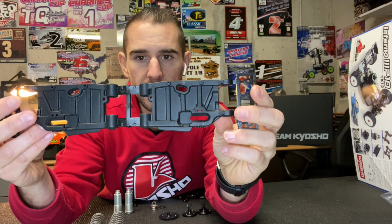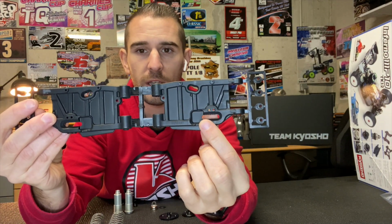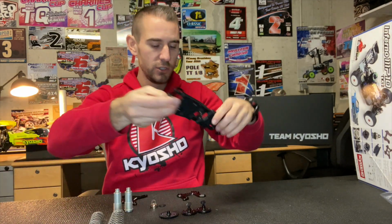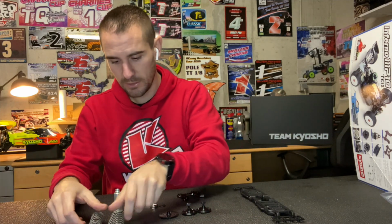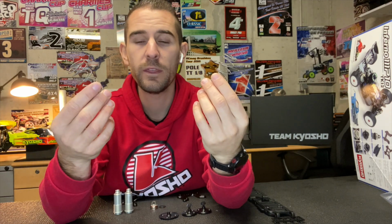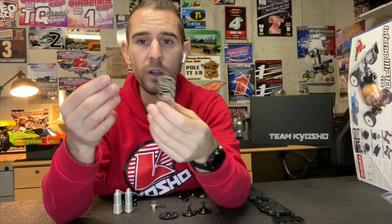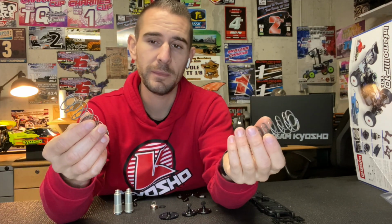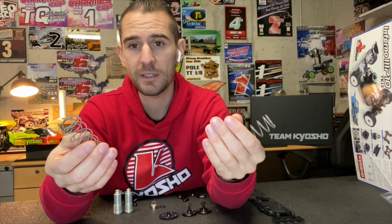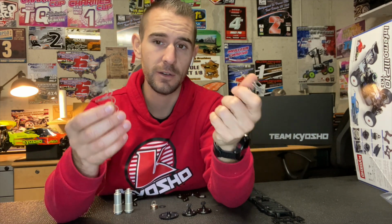The new A-arms for the rear. There is more room here for the spring cup. With more droop, it was touching here, so they changed it a little bit. Soft version front and rear. New springs, gray front and rear also. It's coming with the new towers. It makes the car easy to drive. Of course, you can use all the springs you had before. 70 millimeter front, 81 millimeter rear. That's what I use personally, but the basic with the higher tower is 78 front, 85 rear, sorry.